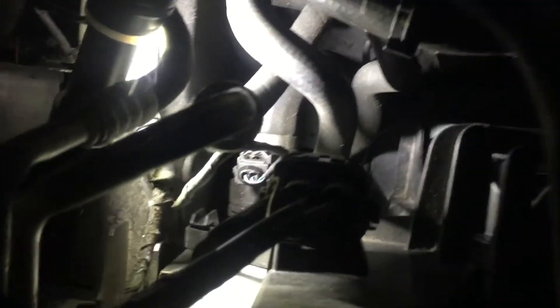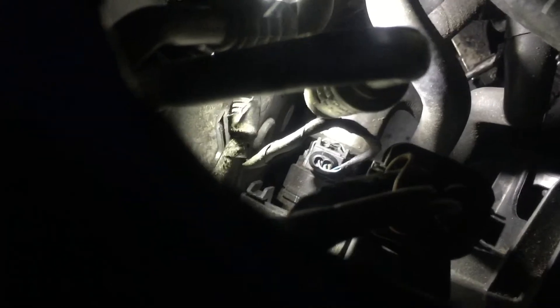There's just the one wire clip. When you go to remove the wiring, you simply press on that silver wire and then pull up — pop the wiring right off. Then you'll squeeze the tabs on either side of the coolant temp sensor and simply pull it right out.